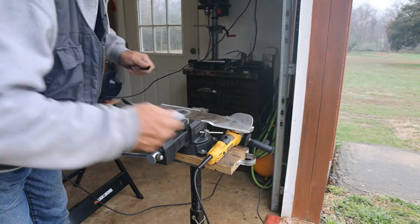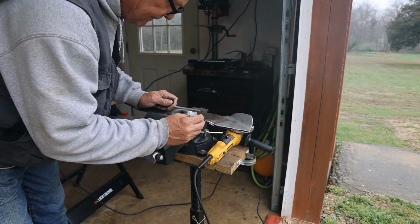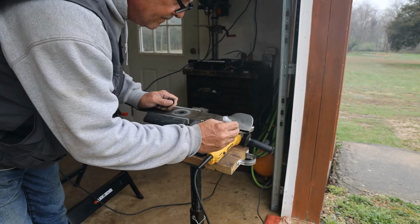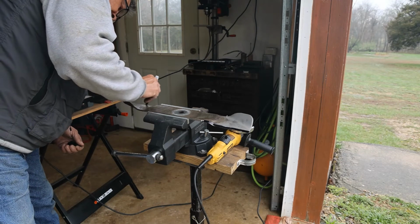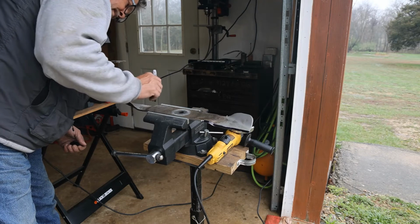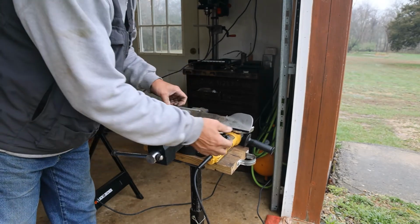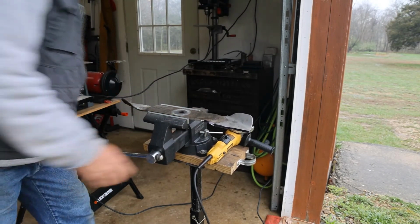Well, this blade has a little deeper gouge on it there. I'm going to take a Sharpie, mark my edges out. That way I know where I'm at. Catch both sides of this guy while we're letting this dry. And we're going to use the angle grinder and just take a little more steel off of this one than we did our center blade.